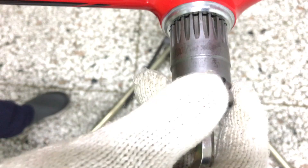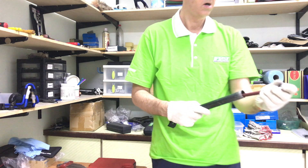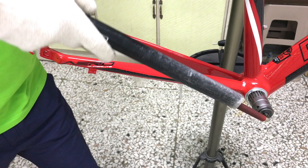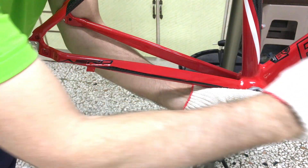The challenge is loosening the drive side, which is actually the cartridge body of the bottom bracket as a whole. You'll probably have to use some leverage here — I'll use a seat post to give me more length and extra leverage to break the unit free of the BB shell. If you don't have an old seat post handy, any narrow diameter pipe will do.